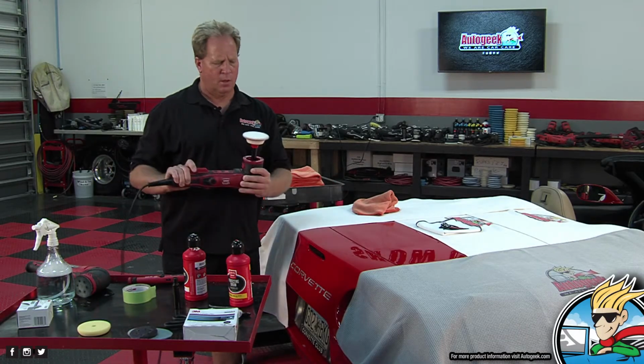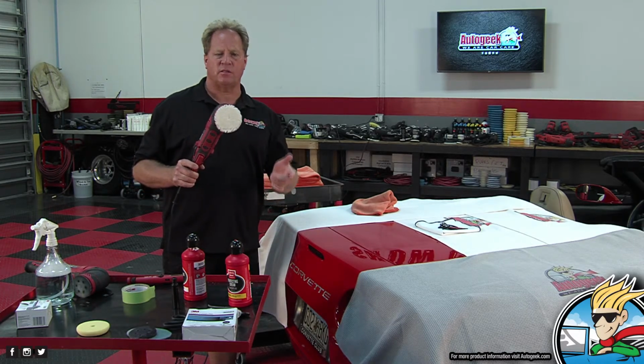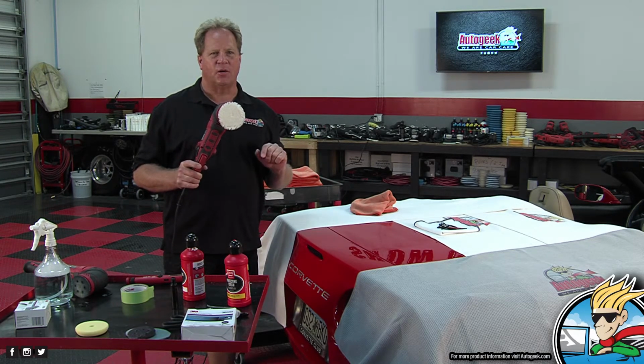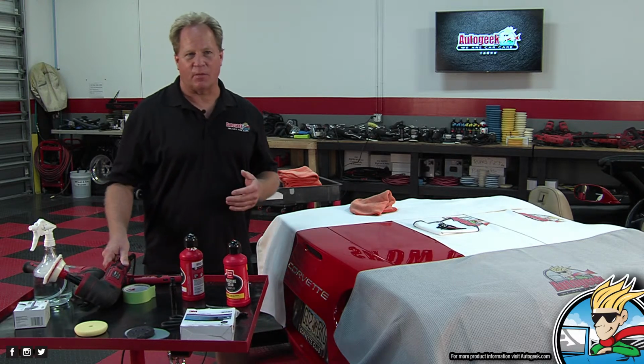There's 8. And if you ever are working on a base coat, clear coat paint system, and when you turn your pad over, you see the color of the base coat, that's a really bad sign. Okay, so I'm really glad to see that there's no red on here. All right. But if there was, you got to remember, it's not my car.